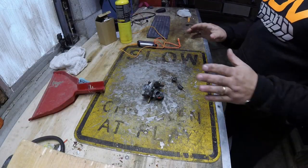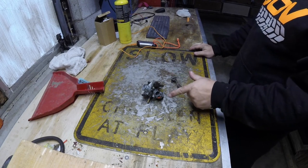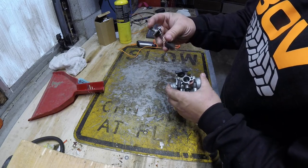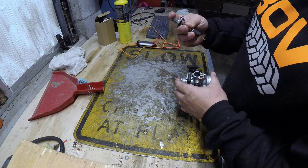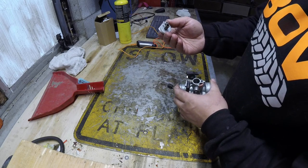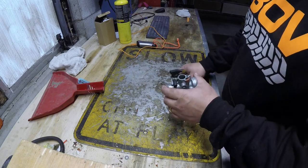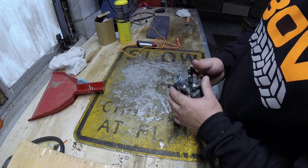So we've got two of the three: compression and ignition. The big one we've got to work on so far is fuel. It's winter here in Kentucky, and we don't have terrible winters, but it sure makes it cozy to have a good fire going. The shop's starting to warm up. Our first major issue with getting the bike to run is this carburetor problem — we've got RTV in some unholy places. The slide assembly's been removed; nothing inherently wrong with that. It's just that carburetors don't like air leaks, and this has many of them — two holes in it, no seal on the outside. That would indicate this booger would likely run lean.